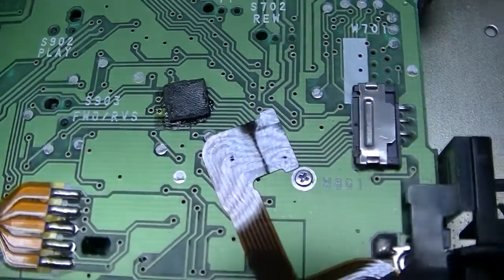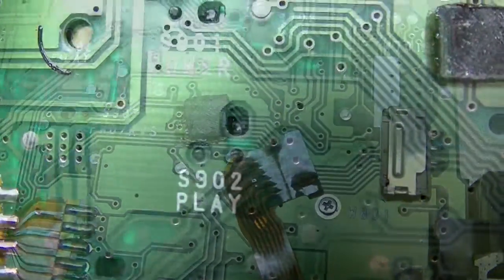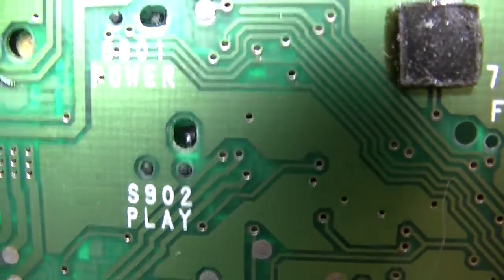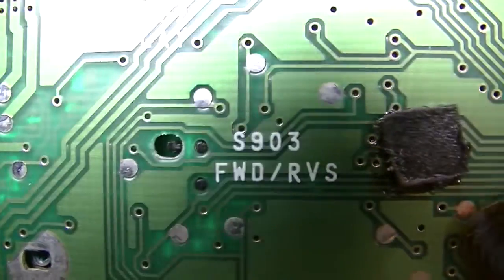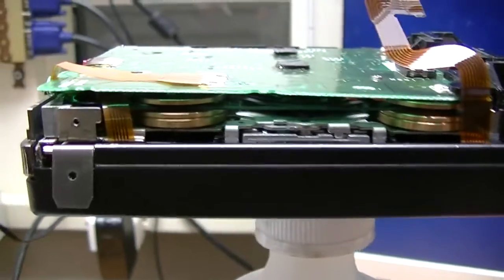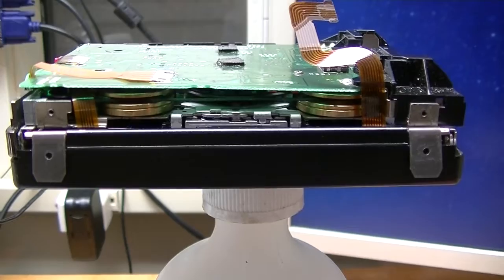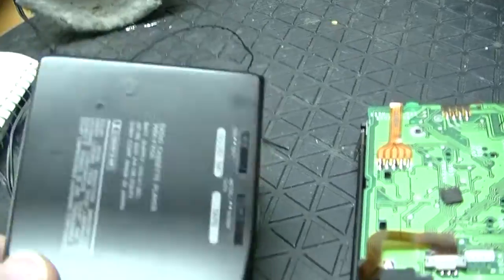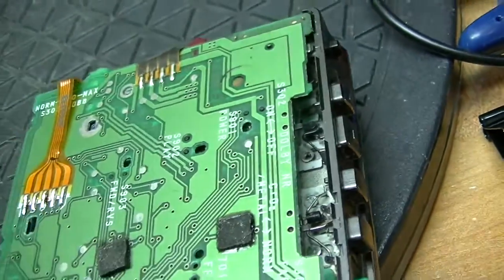There are switches on the audio board which must engage with levers on the mechanism — there's play, and you can see the plunger in there, power, and forward-reverse. Make sure that these parts are outside before you put the case back together; they will want to fall in and that just makes life miserable. So you'll be reassembling it in this orientation. These two switches here will find themselves down, so make sure that these two switches in here are in the down position as well, otherwise you'll have a problem.